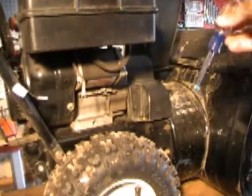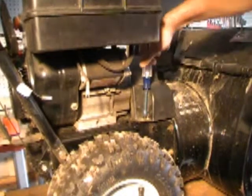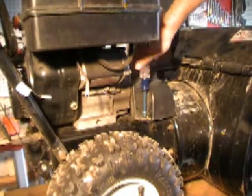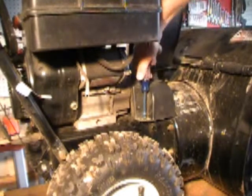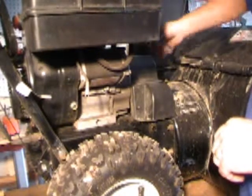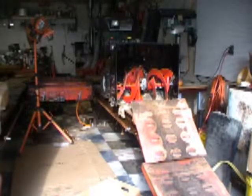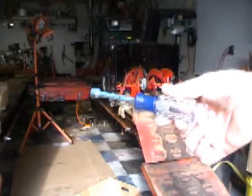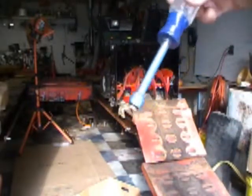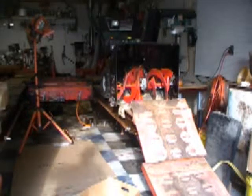Move this back over here so you can see. I'll go around the other side and put the other one in. Just so you know, the other bolt for the belt cover — you can just barely put it on with a nut driver. If it was longer it'd be better. If you have to go in at a slight angle, you can always do it with a small wrench. That would certainly work a little better, but I managed to get it on there.